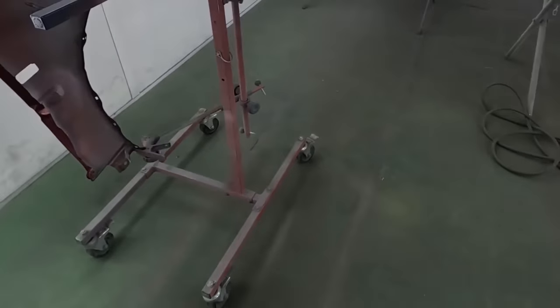Once again, when spraying this, you want to spray it as evenly as possible. If you spray too much in one area, you might get a darker area than you would on the rest of the panel. So make sure you're overlapping around 75% and getting a nice even stroke. And after 2 coats of mid, it's really got a deep red look, even deeper than it was with the base. Now you're going to want to give this a good 20 to 25 minutes.